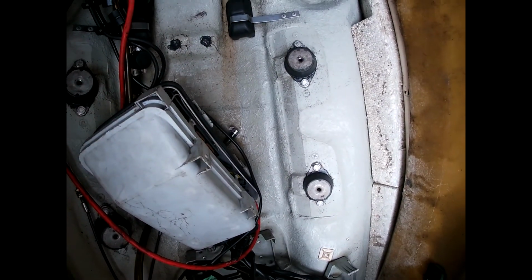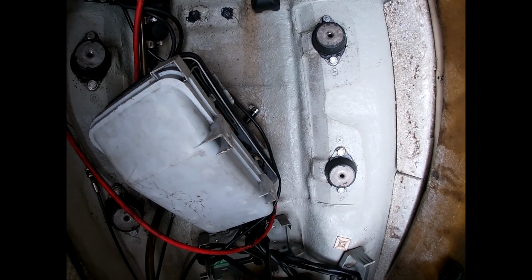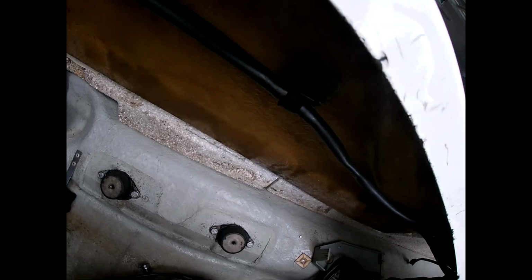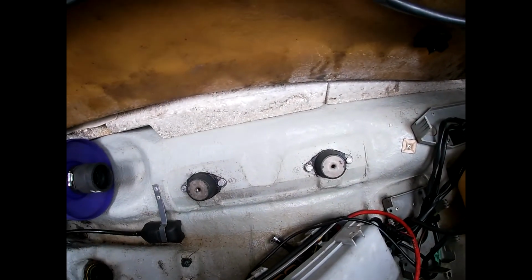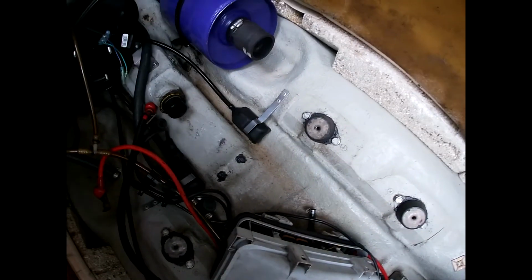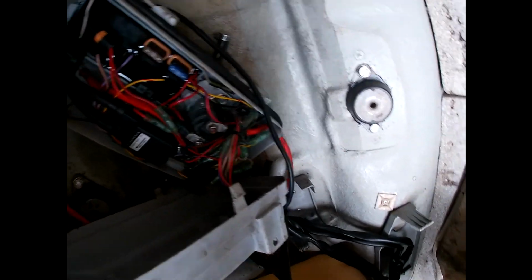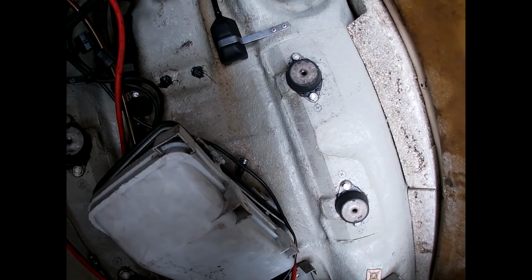All of the fuses in the e-box were wrong, so I've got to get new ones for that. As far as I know, it's a 15, a 5, and a 7.5. So I gotta grab some of those. I have a 15 and a 5, but I don't have a 7.5. I think I gotta try and get red ones of all of them. If there's a difference, I don't know. So that's basically it. E-box is fine inside. Everything is good. We tested the solenoid and everything before when I had the old motor, was trying to get it running. So no, that all works.